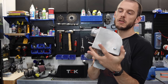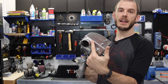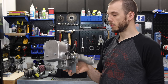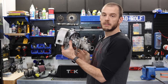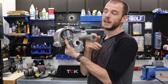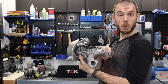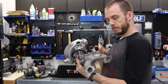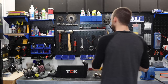This was also done by Fusion Fabrication. Blow off valve output here, inlet is here, and then you have your pressure takeoff for the rising rate pressure regulator for my fuel. And then obviously the turbo carb with a manifold that was sent to me from Steve Blakemore of Turbo Cooper Sport. This has been ported, so it's very nice and pretty and smooth inside there. And then modified with a few sensors, which I'll also talk about here very soon.